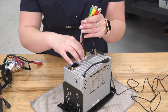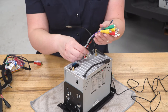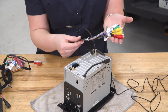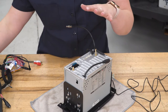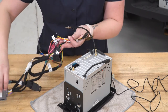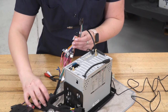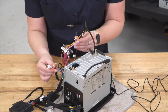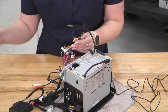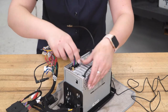Our next connection is going to be our RCA — this is going to be all of your inputs and outputs for your stereo system as well as any cameras or front-facing cameras on your truck. We are not going to be using this, so I'm going to put it to the side to save a little bit of wiring since we're just going to be using the factory connectors. Next is our factory connector — this is our main wiring harness. The two plugs are going to plug into our factory harness. This is our main control box and we also have a relay here. These two cables are going to go to a factory backup camera, and there's a plug-and-play option for the backup camera if equipped. We do not have that equipped on our Silverado, so I'm just going to plug that in to the back there — make sure that you hear a click.